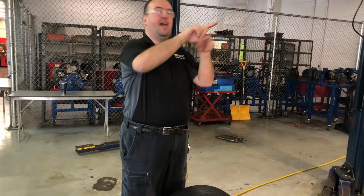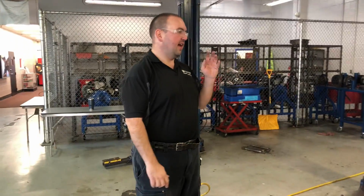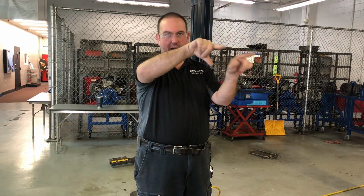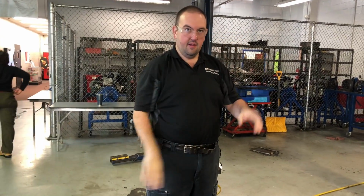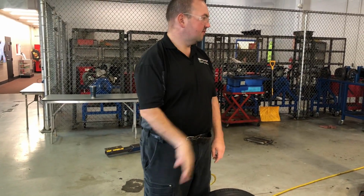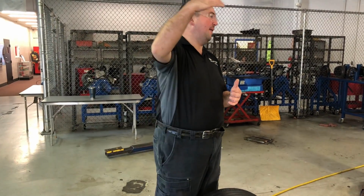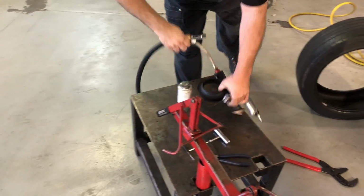Now, they also can't be too close together. I don't remember the exact measurement. Your book does give you a measure. But basically, if they're going to be anywhere near where the 2 patches would even come close to each other, you can't do the repair. And most places will only allow you to do a repair up to 2 times. After that, the likelihood of a tire leak just keeps going up astronomically with each hole. Make sense? So, here's the steps.